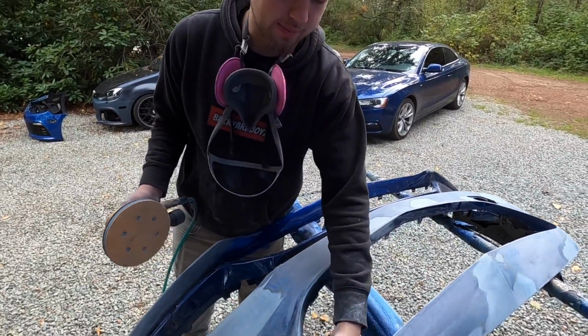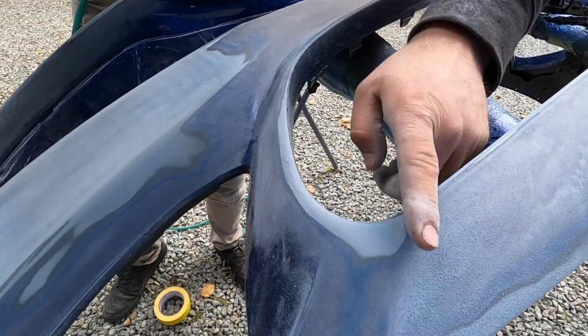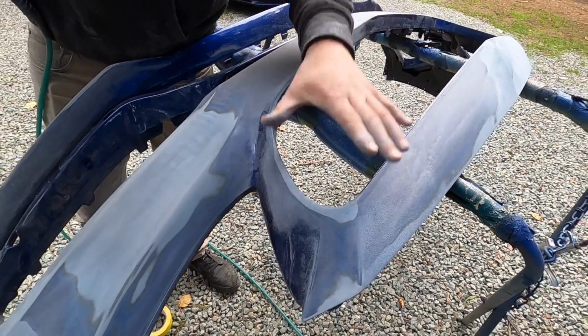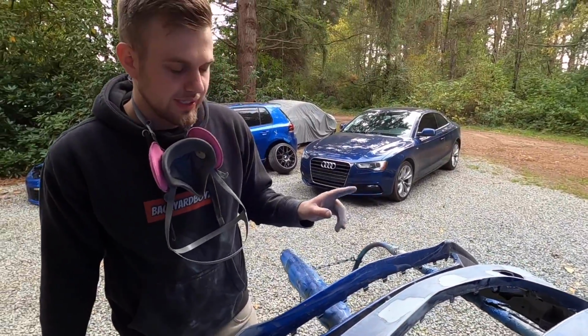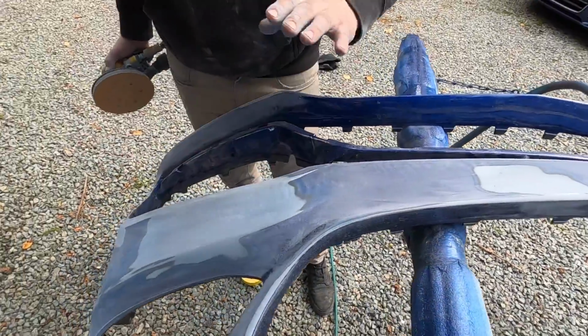By reworking the body lines, I mean the scratch was right over here. So what I ended up doing was making it just a little bit sharper and then rounding off the body line, so you'll never in your life tell, and there's going to be no glaze, no mud or anything. But we did need some glaze in some very deep scratches, like right over there. And then we used just a tiny bit on the deep ones.